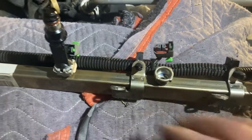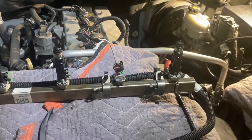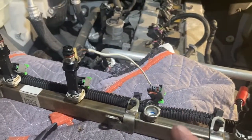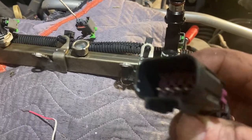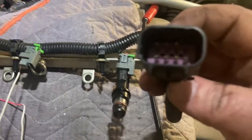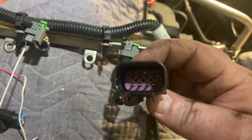The red washer goes toward the engine side and the blue toward the rail side. I was troubleshooting a P0205 code, which is communications loss to the number five injector. Since this thing is so difficult to get to — considering you've got to take off the intake manifold — what I did is I used a multimeter with a piece of wire extended into the connector, and measured using an ohmmeter continuity tester to verify connectivity between both ports on the electrical connector for number five and the appropriate pin on the connector over the valve cover toward the back of the engine.